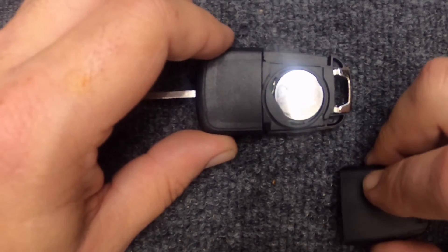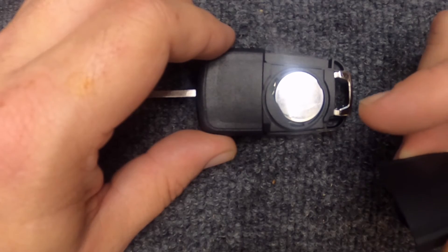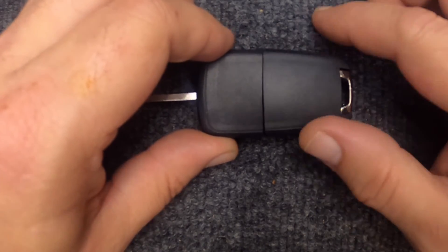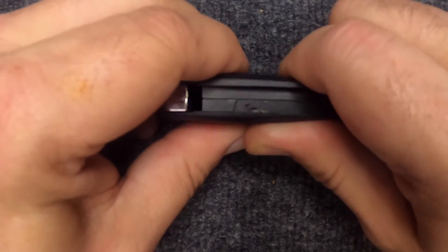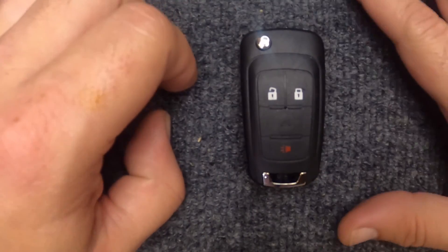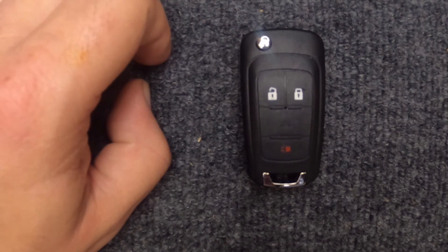Once it gets under, pull back on the battery so it latches. There's that little piece of plastic that's going to hold the battery down. If it wasn't in right, the battery would be popped up, so you'll know you need to redo it. Take your two halves back together, put the back half on, gently squeeze the two together, put the flip key back in, and there you go — you just changed the battery on your three-button flip key remote. Thanks for watching, Sergeant Locksmith.